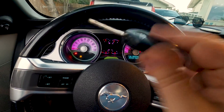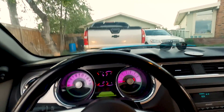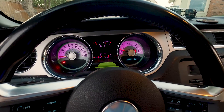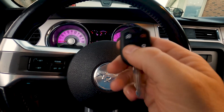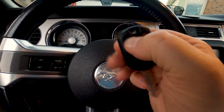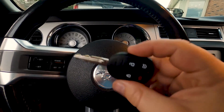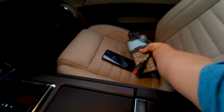Let's shut the key off, cycle it — this is the cut key — and I'm going to try to start it. There we go, the car is now running with that key. I still have the original key; I'll take the new key out and verify the original still works — just like that. You need to understand that in this case it does not program the fob buttons — those still do not work — but there is a separate procedure for programming those. This key will open the door and start the car, which is what we wanted.